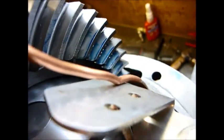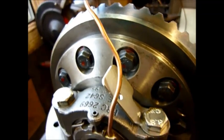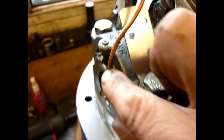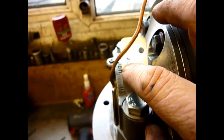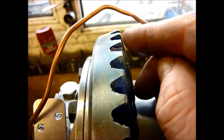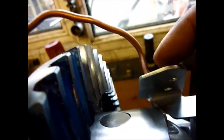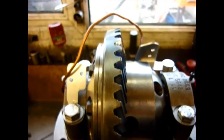That puts that plate in place. On the other side, do exactly the same with the other plate, with the copper pipe going over the top and coming out of the hole at the bottom. You will need to remove the bung that holds the copper pipe in place. These are then the two main plates that are going to hold the airline in position. Just like before, don't force this down onto the air ring — shape the plate so that the pipe is just resting on it, and all you're doing is securing it. If you yank the pipe down you'll cause a bigger air leak. Do a minimum gap across the top, bending the plate over and coming down onto this one.